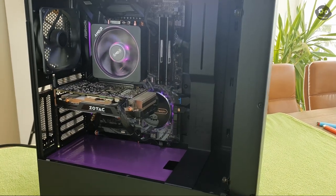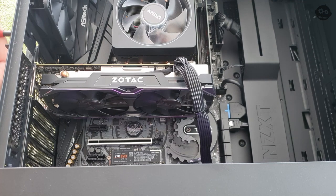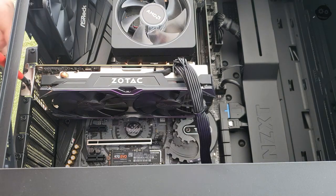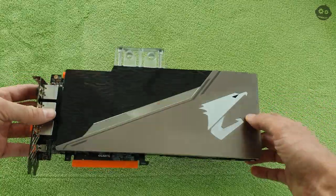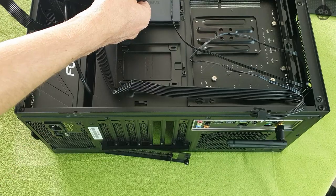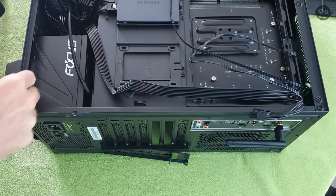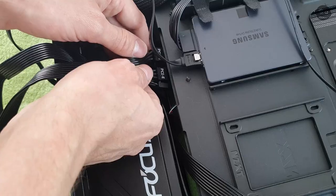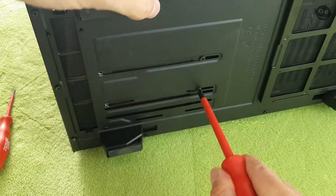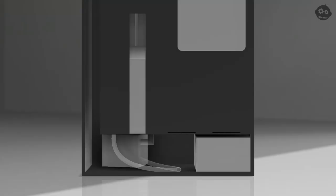So that's how it all started — we had no water cooling implemented, just a stock fan and my old 1060 from Zotac. We removed the graphics card by unscrewing it and removing the power plug cable. That's the new graphics card with the 8-pin connectors that we need to put into the case. We open the back, put the old cable out, and put the new 8-pin cable in place. You just need one cable, you don't need both. We bring them through the back and to the front, and remove the hard disk enclosure at the bottom of the case, as the pump will go into its place at the bottom.